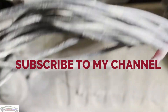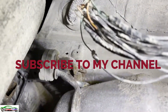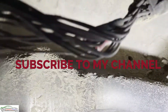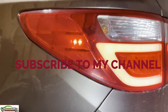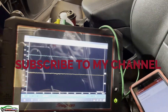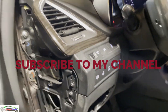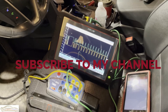Now we are back - the vehicle is running and the CAN communication is back to normal. I reconnected this and it's still good. I'm going to take it for a test drive. These blind spot modules live behind the bumper on the left side. Now the communication is back to normal, I don't see any weird looking signals. I'll put everything back together since I removed a whole bunch of stuff, take it for a test drive, and see how it goes. I'm happy I have communication to every module now.